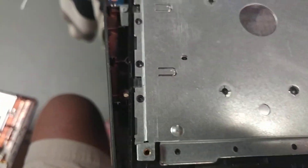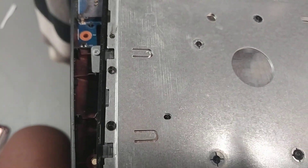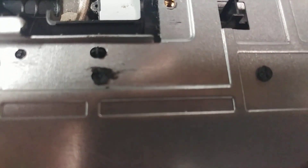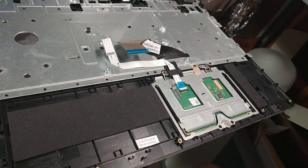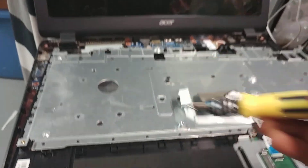And as you may have noticed, the keyboard is held by plastic tabs. I used a soldering iron to remove some of these really thick ones, but I've actually found a simpler way to do it. Just grab one of these little flatheads — I have a complete set right there. All you have to do is just reach underneath and just pop up and it will come off.